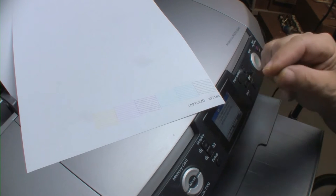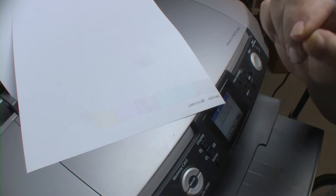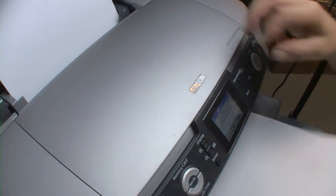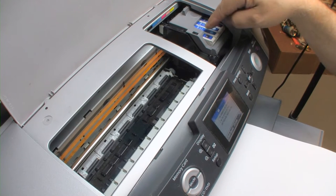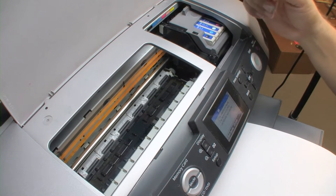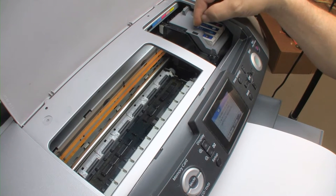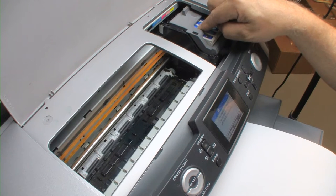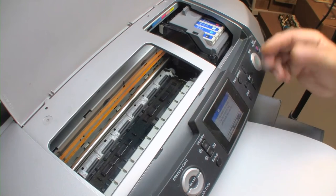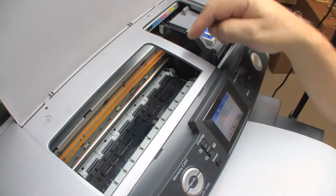Now that I've achieved that — and this was the primary goal in reviving this printer — you have to get a perfect nozzle check. If I still did not have one, I would have to resort to physically, and carefully, forcing cleaning fluid through the ink stems. The ink stems are located inside the carriage itself; they enter the exit port of your cartridge, and ink is drawn through them. With a syringe with the proper diameter rubber tubing, carefully extract all the air out of the syringe, insert the tubing onto the ink stem, and very carefully pump in cleaning fluid with the carriage in position and plenty of paper towels underneath to catch the Windex that will pour out of the printhead.